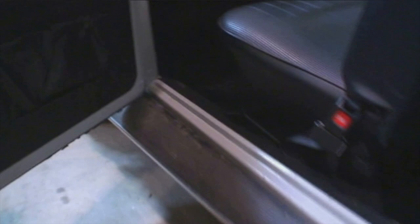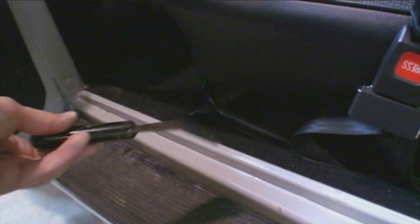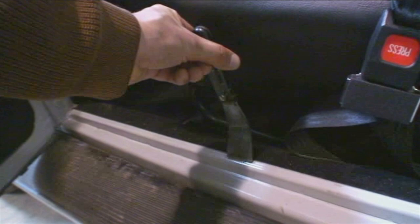One area that might be a little tricky when removing carpet is on this bug right here. There's a lip and the carpeting gets tucked under this lip and then hammered down to fasten and hold the carpeting in. To tear it out, get yourself a putty blade and get underneath this lip and pry it up. When you pry it up all along the channel, you should be able to tear your carpet out on this side.